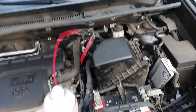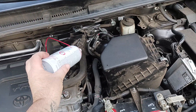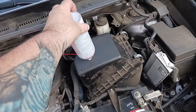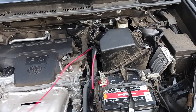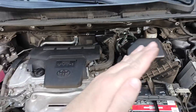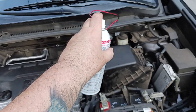At that point, take your bottle, invert it upside down, and press down so that you're starting to spray the liquid down into that throttle body. It's a constant press for at least five to seven minutes. What you'll notice is hopefully, if your buddy is keeping the idle constant at 2,000, you might get a spike in idle and then it might start fluttering. When it starts to flutter, that's how you know there's about an ounce of liquid left in the can. Stop the process and shut off the car.